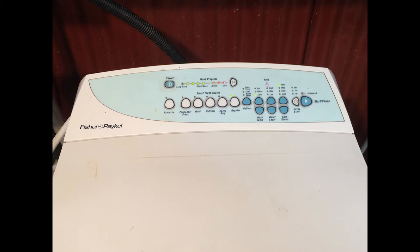These are usually faults that you can clear yourself, or something wrong with a connection to the washing machine. The other kind of fault is what's actually referred to in the manuals as a fatal error — fatal to the cycle — meaning the cycle can't carry on, and for that it makes a continuous beeping sound. Today we're going to talk about the first category, the user warnings, and in the next video we'll talk about the other fault codes.